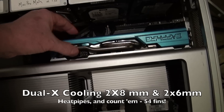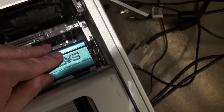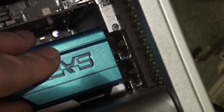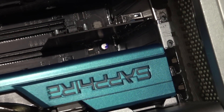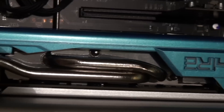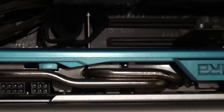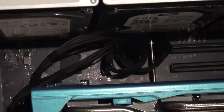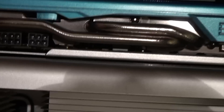Now look at this heat cooling — that's pretty fantastic. Sometimes with these cards the screw holes don't line up, so you want to make sure you slide the card forward by pushing on the aluminum heat-dissipating panel at the back, not on the plastic body. Push it forward, put the screws back in, slide your fan unit forward, and the stainless steel pin will slide underneath the card and lock it into place.